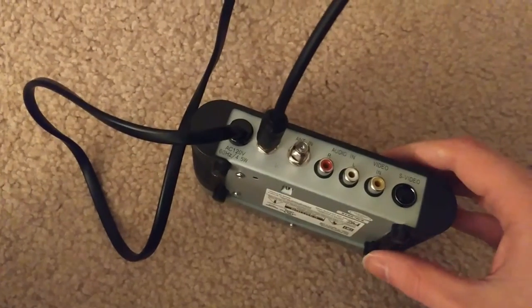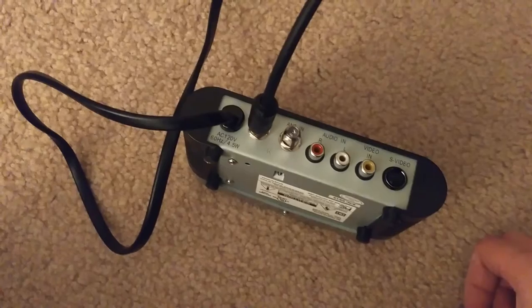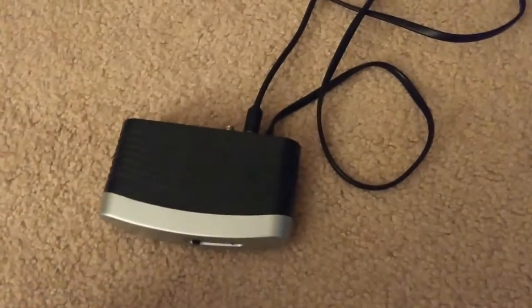Normally, the TV would simply receive whatever you plug into the antenna input port, and the TV out port would be connected to the TV. But once the device receives a signal on the video or S-video line, it kicks in and starts outputting that signal on either channel 3 or 4.